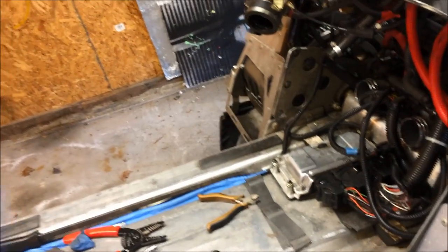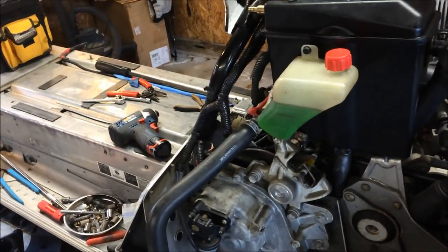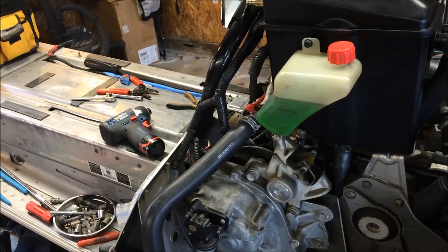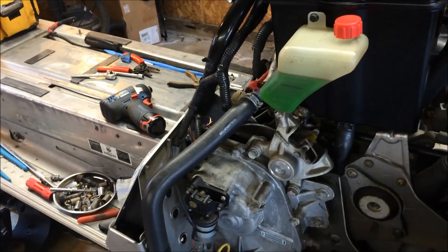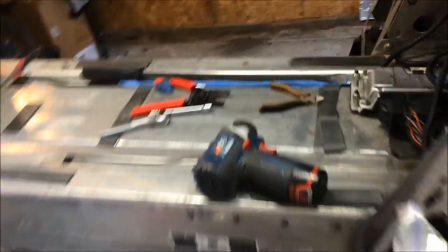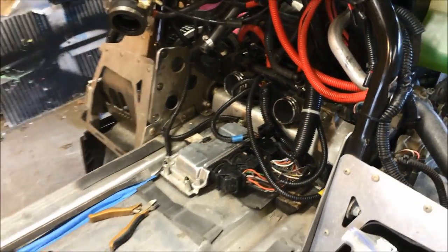During the initial bleed process you may start freaking out because the tunnel isn't getting warm — go check on the left hand side and if it's hot on that side, eventually you'll start feeling warmth on the right side. Then it's just a matter of putting it back together, running it a couple times to make sure the coolant stays at the same level, and at that point you're pretty much good to go. Just be aware that Polaris didn't change the design of the plug, so the repair harness has the same design and may fail again depending on how long you keep the sled.